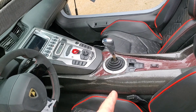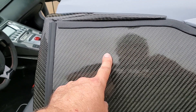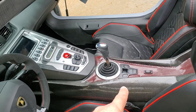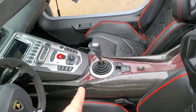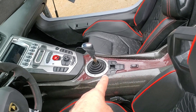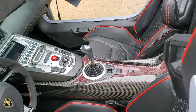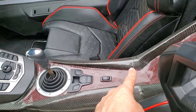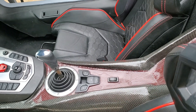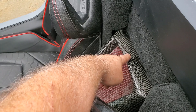This console is not all finished. You've seen what finished carbon fiber looks like — it's not quite a mirror finish but it's a much nicer finish. It's got a little orange peel but you can sand and buff that out. It still needs more epoxy layers, but for the car show I just threw it in because I didn't want to rush it. We've got carbon fiber Kevlar in there — red Kevlar — and we're going to trim it out with some paint. We did a little herringbone here which turned out okay, but we may put a stripe across that.